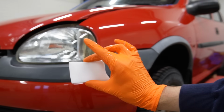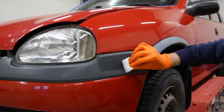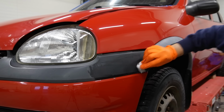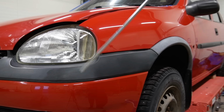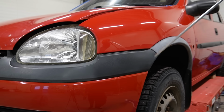With the whole car now polished, let's tend to the trim. And before putting on any plastic dressing, I like to scrub them down with a miracle sponge to clean up the layer of dried up oxidized plastic. This way I find the plastic restorer to last longer as well, and just gives it a better overall result.